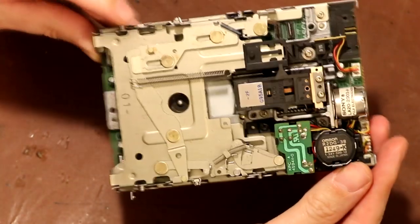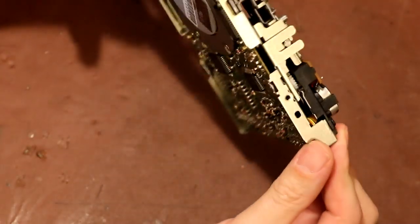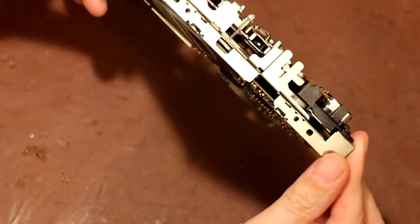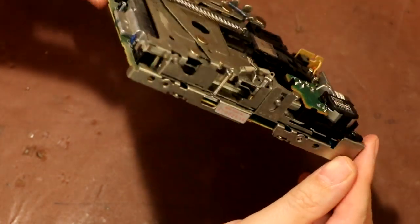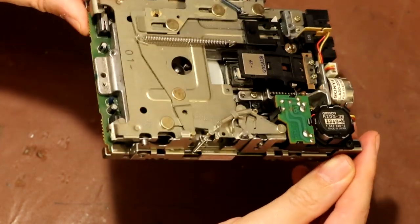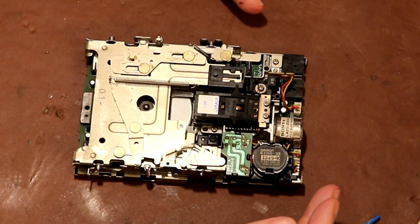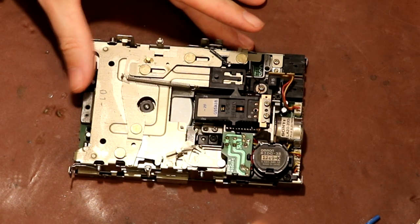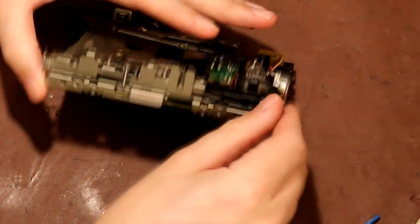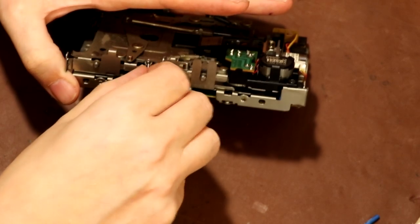The only thing I can find with this drive is that it's actually quite dirty and contaminated — all the grease that would normally lubricate everything is very very dry. In fact the grease has gone solid, it's more like glue than grease. So all I can probably do for Richard is a quick service on the drive and see if we can get the mechanism operating a little bit freer, which might improve things. To service this type of drive, first you've got to make it think there's a disk in — you push this little cam forward and the mechanism drops down. Then you've got a couple of springs to disconnect.